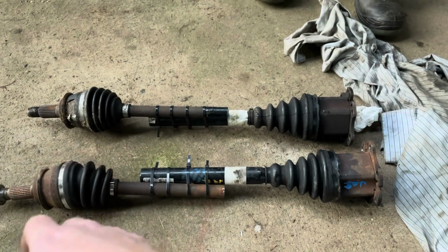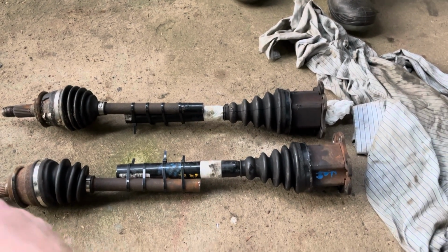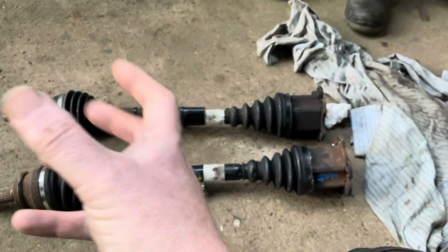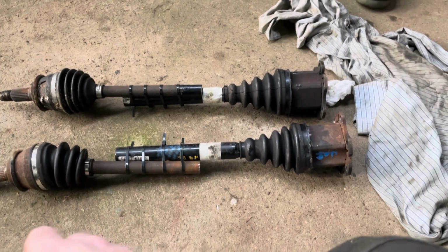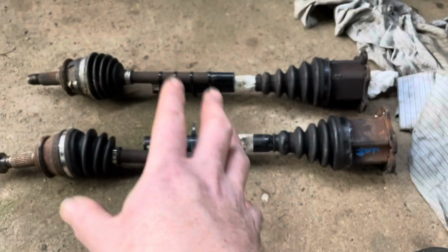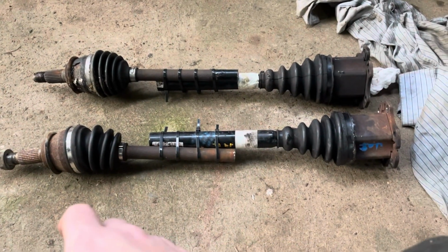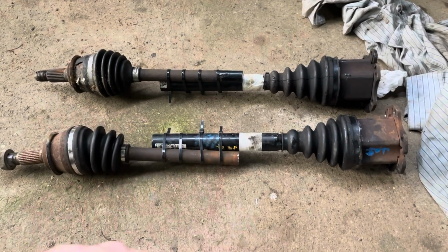Yeah, but if you've got an interference fit, you've got to be spot on first time to know where it is. And the tooling and the machining, which I'm sure you could do, but you've got to be more accurate than a gnat's cock, really. So we think it's just simpler to put a nice snug fit in so they can be pushed in and out. Not too sloppy, that's for sure. And then I'll just take them home and I'll TIG weld them.